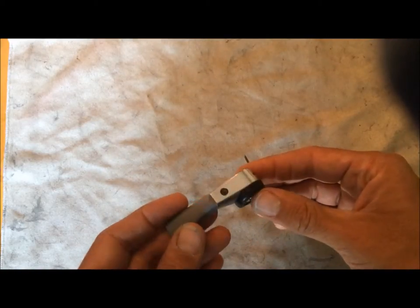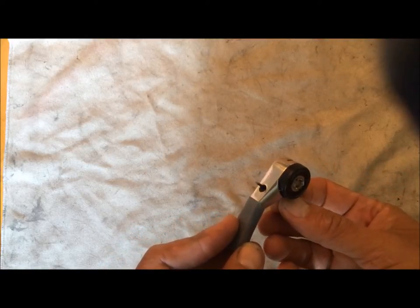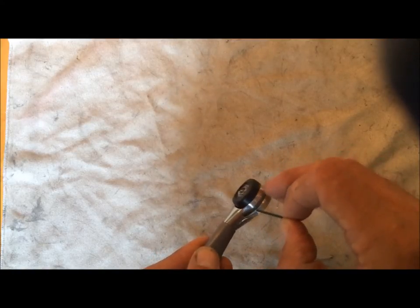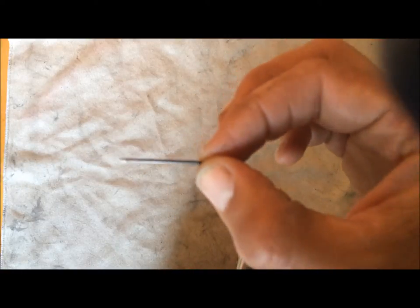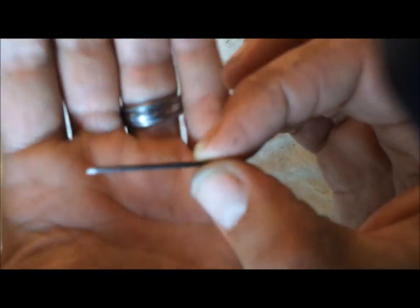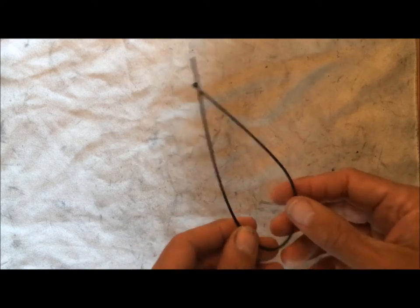Number eight — back with the spoke again. There's a phenomenon of sometimes getting one of your cables corroded up into a bar-end shifter. Pretty common on a lot of triathlete bikes where sweat and Gatorade get in there. Sometimes the cable breaks and you can't get that little head out. This is basically the middle section of a DT Revolution spoke — the 1.5mm section, sharpened, about an inch long. If you cut the cable right at the head of the shifter, these work really well to get that head out — about a 95% success rate.